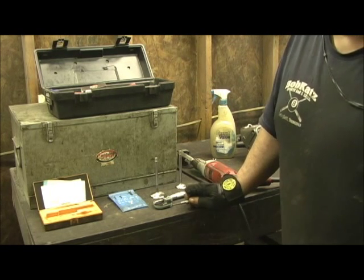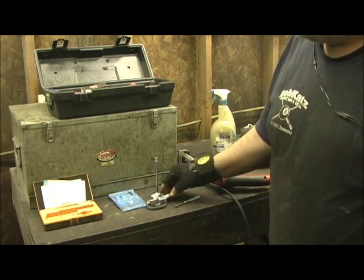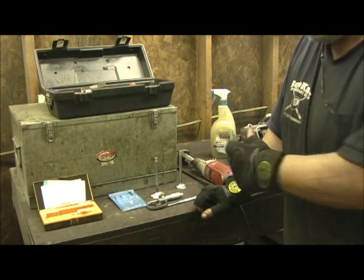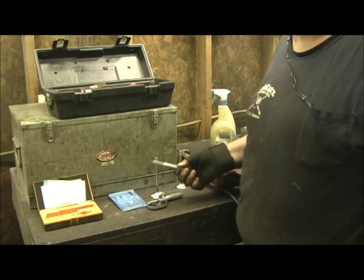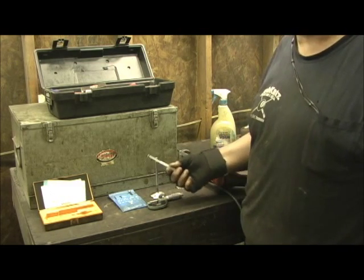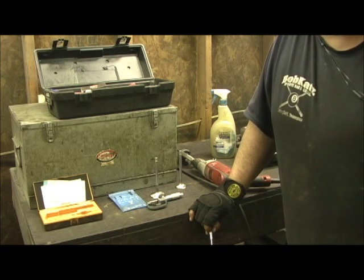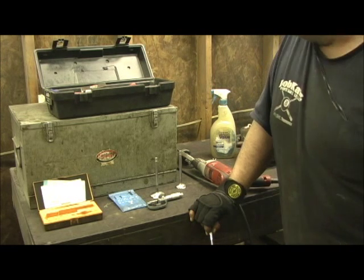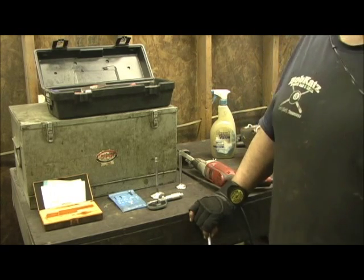So, is it a dial bore? No. But because I'm using this gauge, the small bore set, measuring the valve, and through years of practice, and having the guide hone there with me, I have developed a damn near perfect relationship to where I've got it to where the variance from this tool to that dial bore is .0002. There are people that can't hone a damn cylinder on a bore on a block to that measurement.